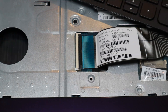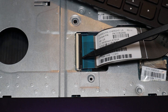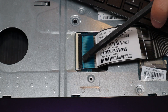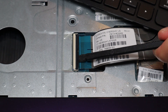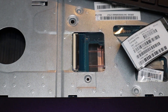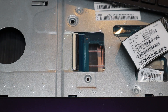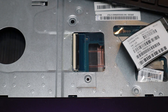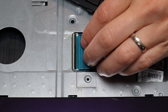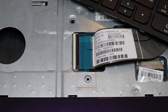To take a ribbon cable out of this kind of connector, you have your ribbon cable here, the port on the motherboard, and then you have this retainer clip. This clip opens and shuts like a book cover — it opens from this side and the hinges are on this side. In order to get that up, be very careful. Take a small flat pry tool, slide it underneath, and pop it up — then the ribbon cable can come out. After taking the ribbon cable out, I like to put the clip back down for safe keeping so it doesn't get caught on anything and rip. These retainer clips are very, very breakable, and if you break one you're most likely not going to be able to find a replacement, in which case your ribbon cable won't be able to secure down anymore. So be very careful. To get the retainer clip back in, pop it up again very carefully, slide the ribbon cable in nice and flush — it may take a few tries if you're not used to it — then snap the retainer clip down. That's how you operate that kind of clip.